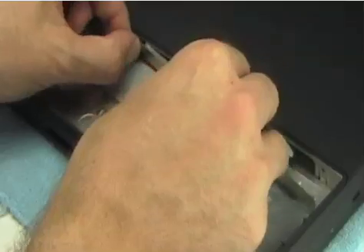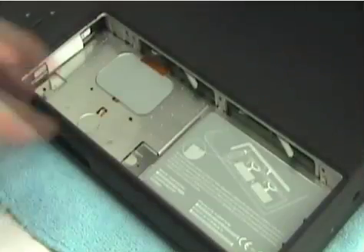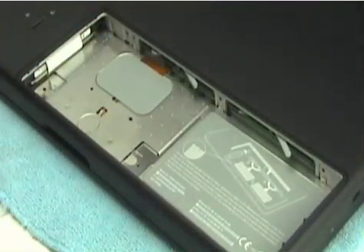All you have to do is unscrew those screws and gently pull on the screw heads to take out that L-shaped bracket, exposing the two memory bays. Over here on the left side you'll see that's where the hard drive is. I'm going to start by changing the memory.